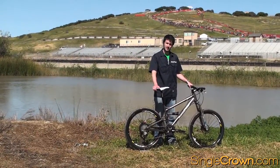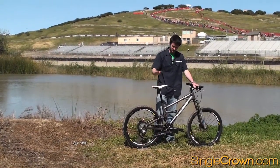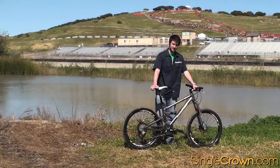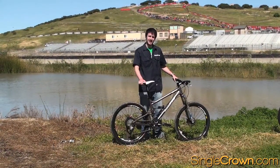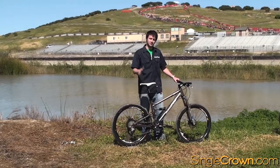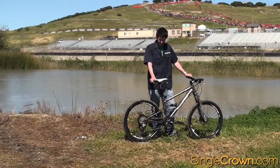It also helps when you're climbing, with the front wheel traction. It keeps your weight over the front of the bike, combined with the geometry, with the fairly steep seat angle. So front wheel wandering is not an issue, even with 160mm forks and a 66-degree head angle on steep technical climbs. The VF 4-bar linkage is designed so that this is a pretty stable bike. It's really designed for high-speed single track, where you're really pushing it. So it's got an initial rearward axle path, which helps when you're hitting square edge bumps because it reacts better to them and maintains your speed more effectively.